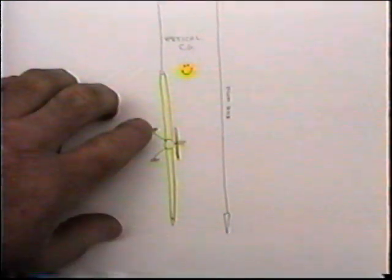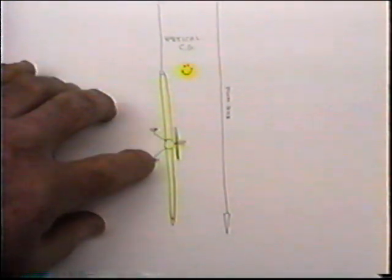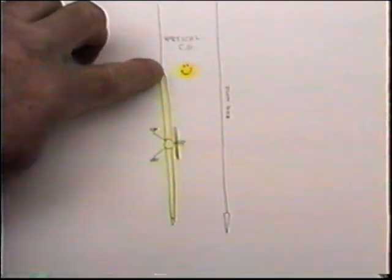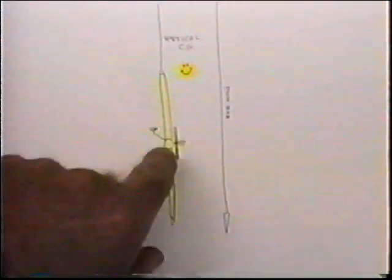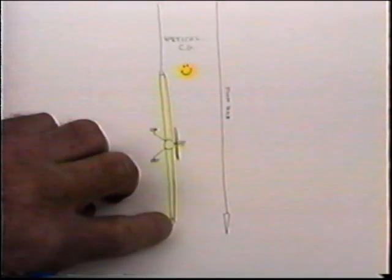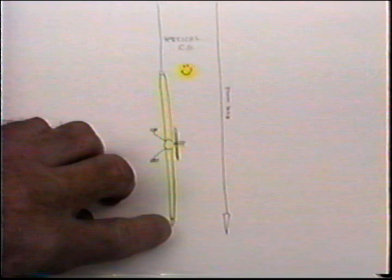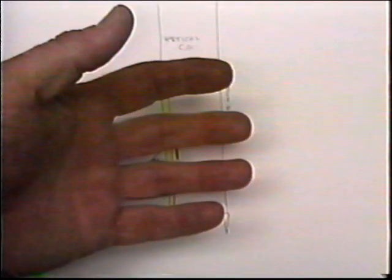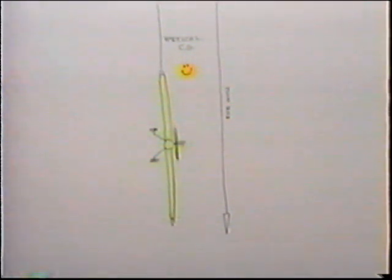Most of the time, though, a plane will need an adjustment to the landing gear, to weights. Another way, Bob Barron has a good way of doing it: he moves the lead outs up and down in a wing. That's kind of inconvenient in most cases, but if you take a plumb bob, it's real easy to do, and you get it to go right through the center of that wing. Again, even if it's off an eighth or a sixteenth of an inch, the reason it's a problem is then you have to compensate for that with a flap tweak, and let me explain that.